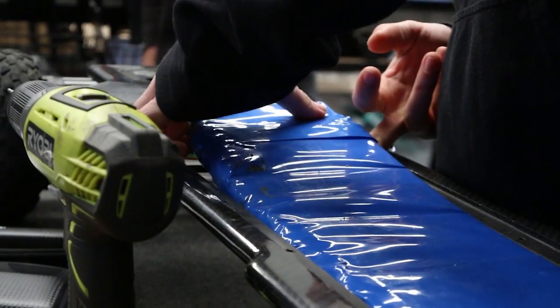The reason why we don't use the 18650 cell is because we would need at least 40 of those cells to make up one big battery like this. Here at Evolve we use the Flatpak lithium ion cells — we use 10 of these cells to make up one full battery. As you can see, 10 of these cells means less soldering, less wires, and much easier to maintain. If ever there's a cell problem we can easily replace that cell and fix the battery.